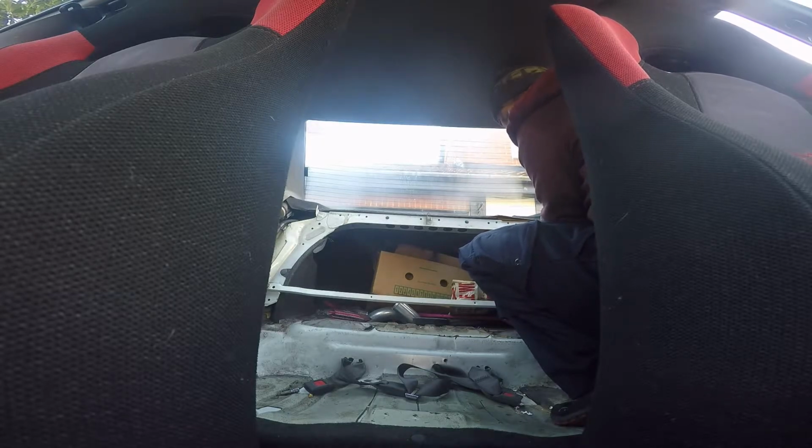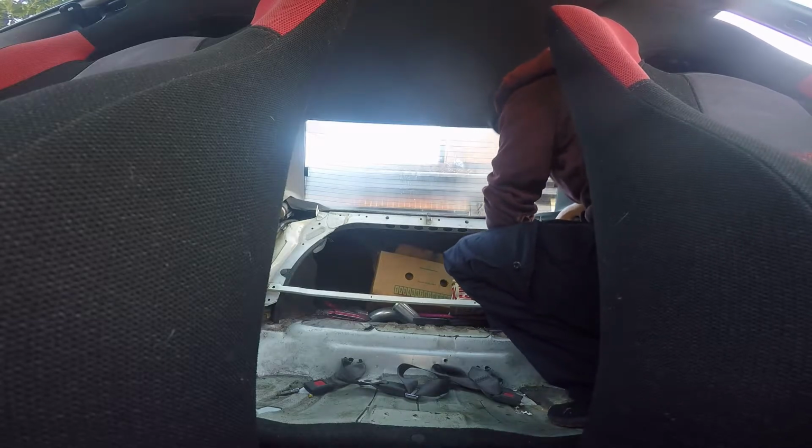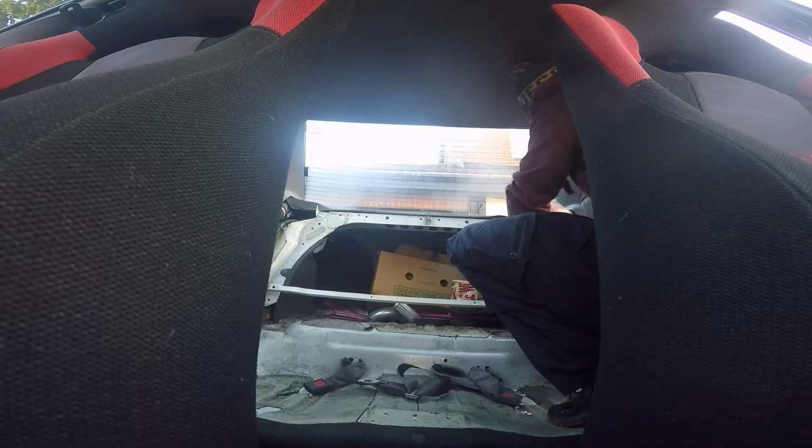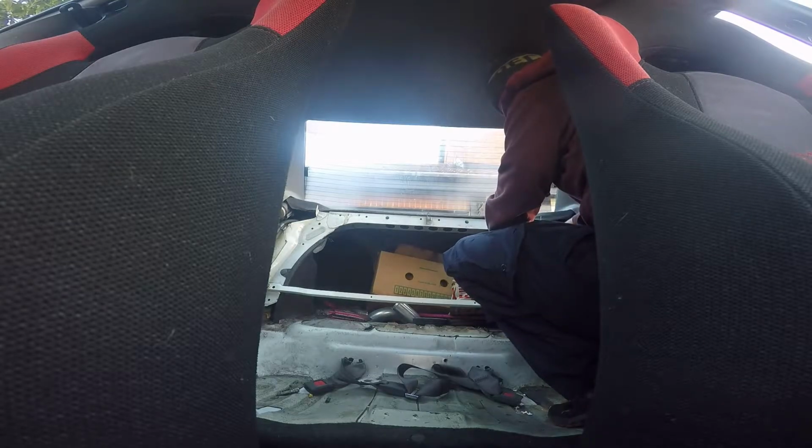So in a version 1 or 2 you have a 17mm anti-roll bar, and I think in the early Legacies it's the same, and then in version 3 to early 7s you have a 19mm roll bar, while on the later GD chassis you've got a 20mm roll bar.